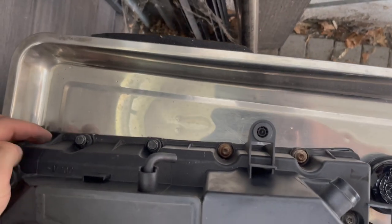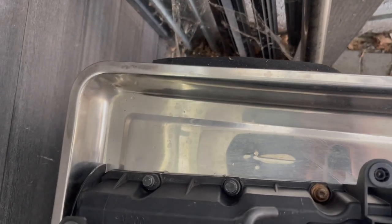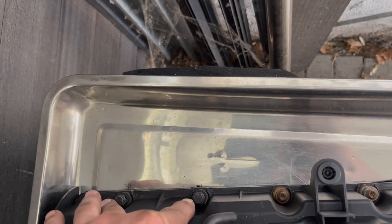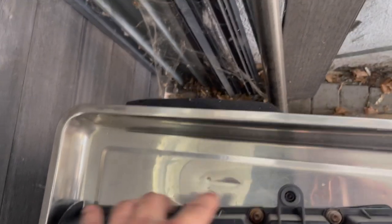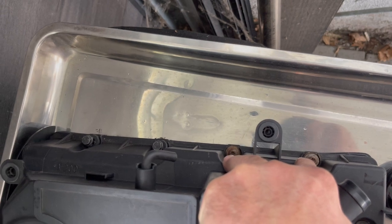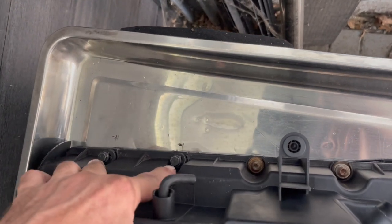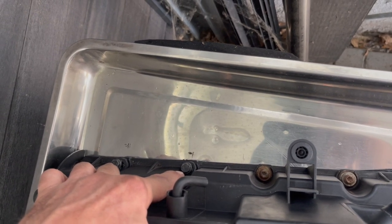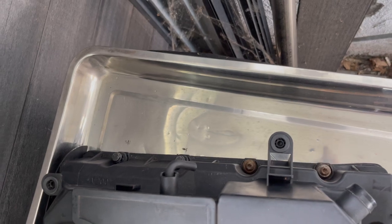Here's a shot of the back so you can see the bolts. I replaced these two bolts with 10 millimeter bolts because I had two bolts break on me last time - these were the bolts from the ASZ valve cover. I found that the 10 millimeters are easier to locate than trying to get a T30 Torx in the back here. The other two are more difficult and very hard to see without the perfect angle, so swapping those two out with 10 millimeters makes it a lot easier.